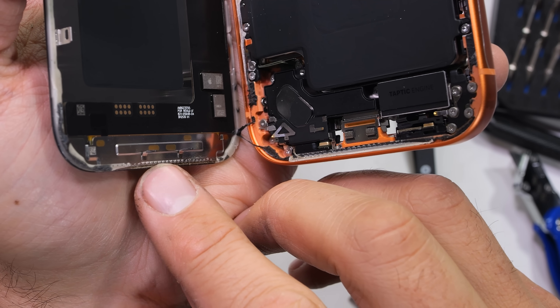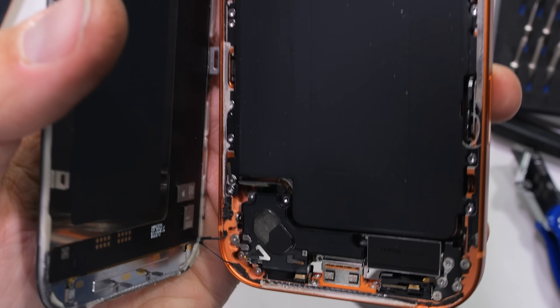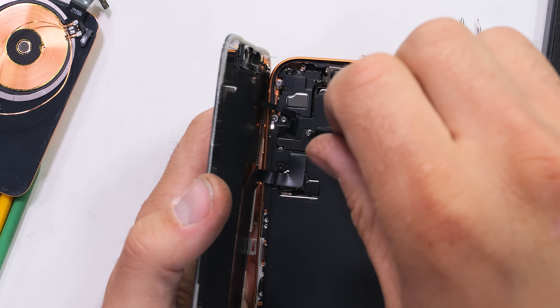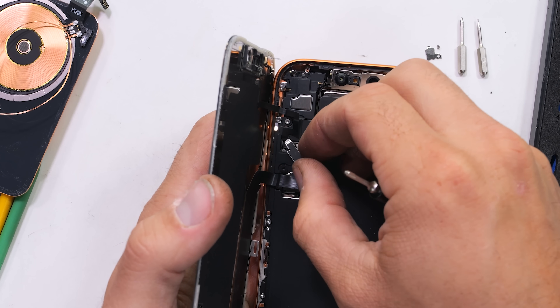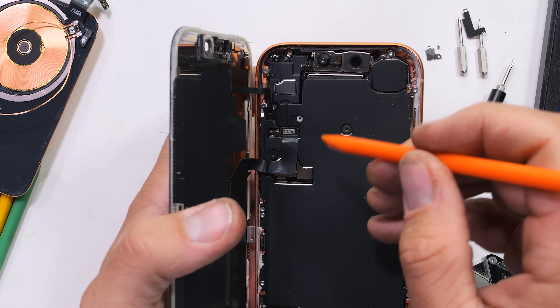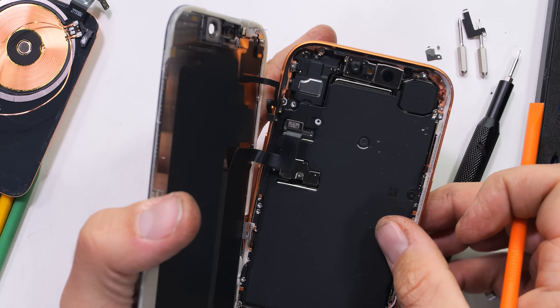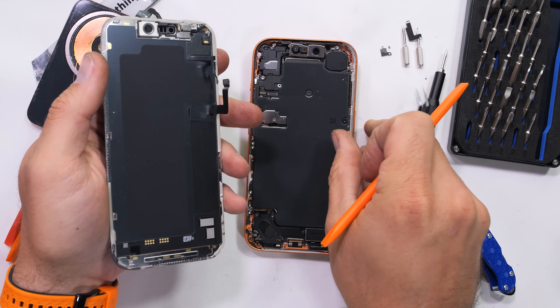You can see where I sliced into the screen on the lower portion when I inserted my tool too early. The screen has two ribbons on the left side with a Phillips head screw holding down the Lego style ribbon connector. This iPhone 17 Pro screen could be replaced by an experienced technician in about 2 minutes. Apple does now sell replacement parts directly to customers, which is pretty cool of them — thumbs up for that.